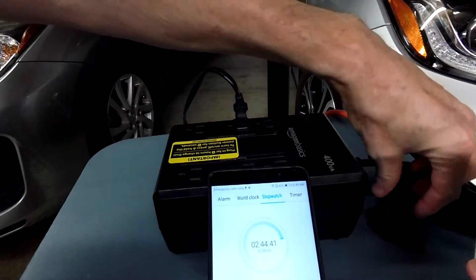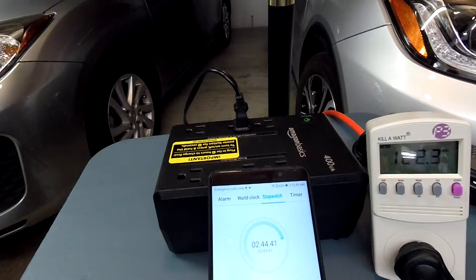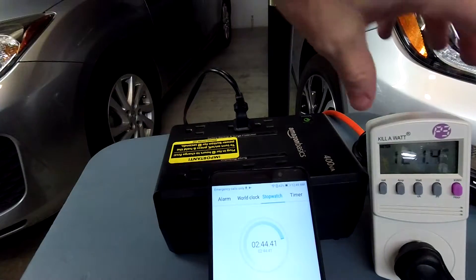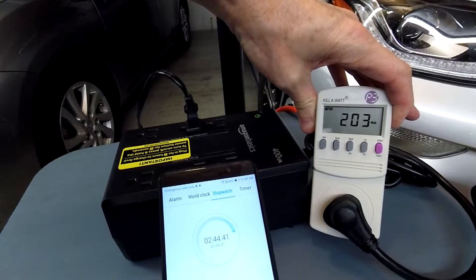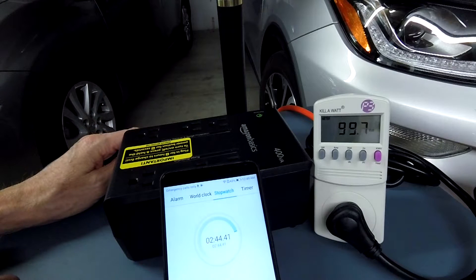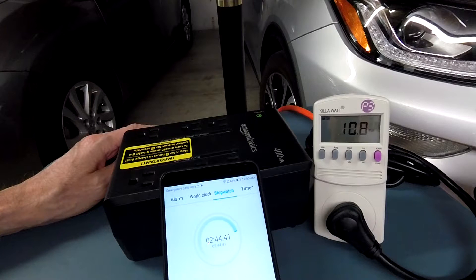Let's restore power. It keeps the last known setting of the power switch — that's good. It's now drawing about 203 watts powering the lights, compared to 196 when the battery was fully charged. Unplugging the light, it runs at about 10 watts to charge the internal battery. Based on the sticker, I'll assume it takes about 8 hours to fully charge from dead.